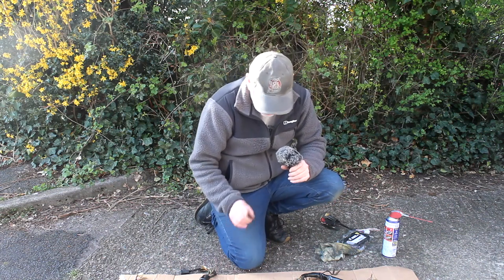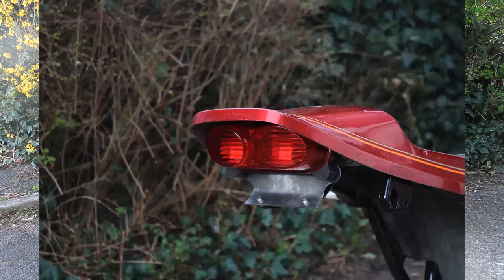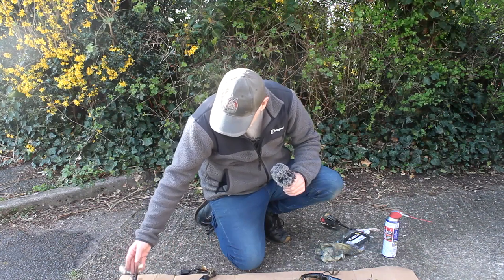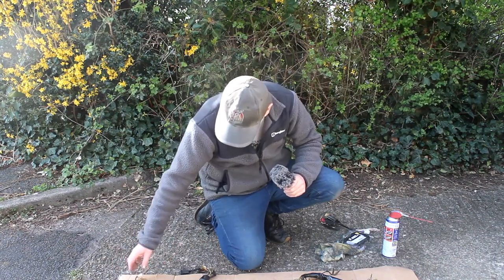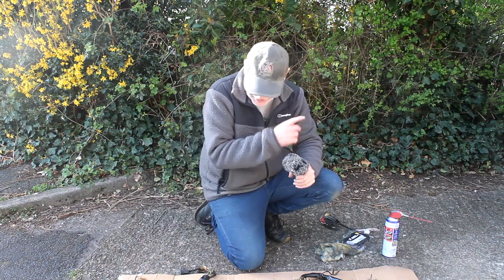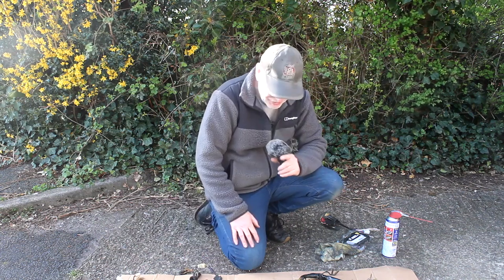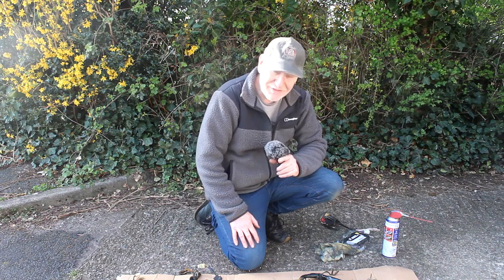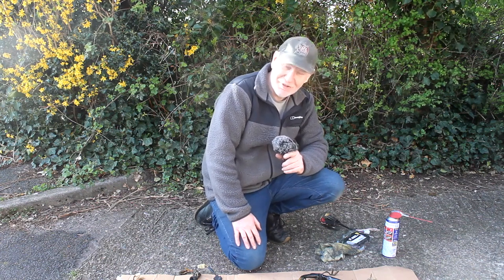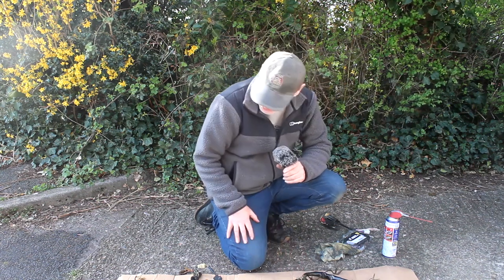I've also got to make a few more changes because at the back for the rear brake light I've got a different brake light — off a Kawasaki ZR7S — so that's all different. I've already cut off the multi-pin connector and changed it to bullet connectors, so that's fine. The good news is that an old bike like mine from 1978 has far less wiring than a modern bike — a modern Kawasaki's wiring harness would be three or four times as complicated as this.